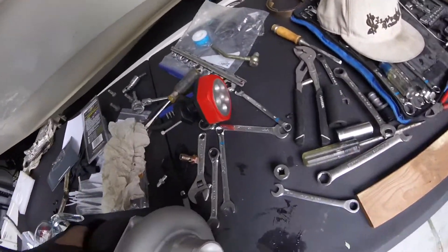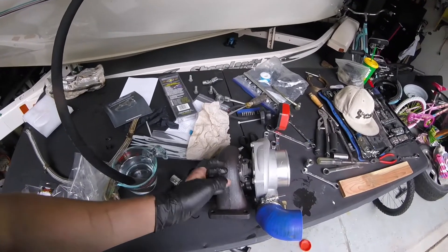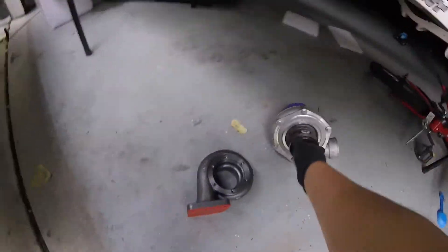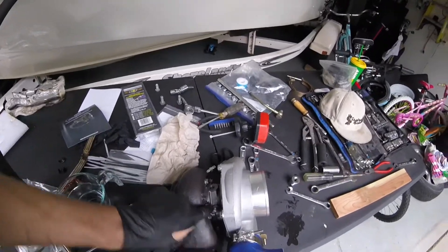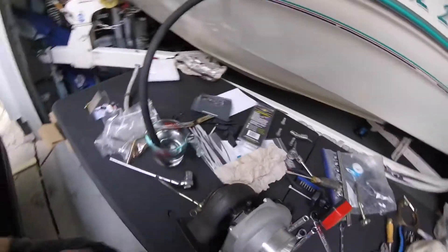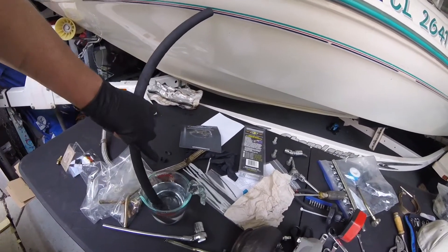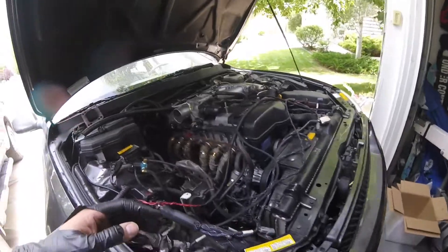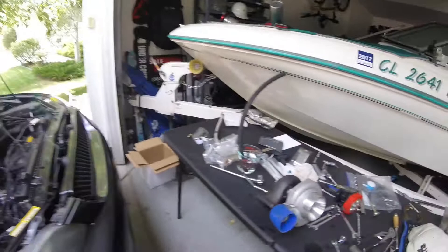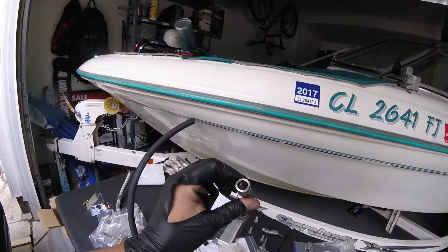What I did is I actually reused the exhaust manifold turbine housing off the old turbo and put it on the new turbo, which honestly I think the old turbo is fine. So I'm basically using the new center section and inlet and then the old exhaust housing because I didn't want to have to re-grind that down. I'm warming up the end of the oil drain line in some hot water so that I can slide it up on the barb real easily. I'll get my exhaust shielding on that and then we'll be able to fit it down in here and put it back in. I've also got to screw my fitting back into the block for my oil drain line - I took that out so I knew what size I needed at the shop.